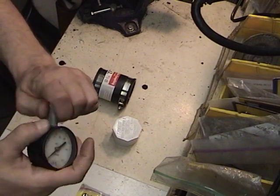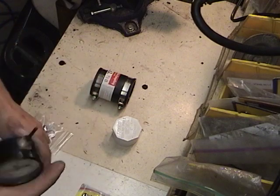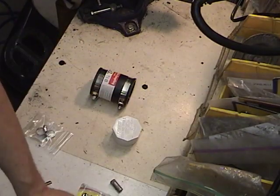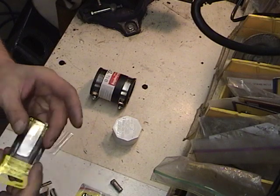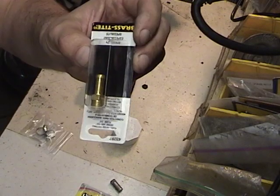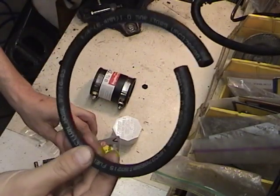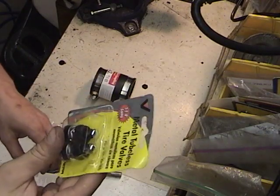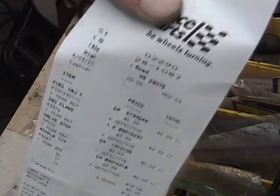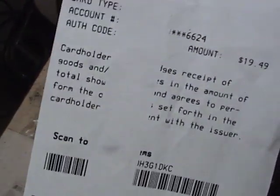When you buy these little tire gauge things, if you unscrew the bottom off, what you find is NPT threads on the base. You take the gauge and a couple of quarter-inch NPT couplings — these I picked up at an auto parts store — a quarter-inch fuel coupling, a quarter-inch to quarter-inch coupling, some fuel hose, and some clamp-style tire valve stems.